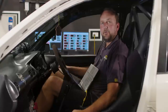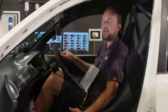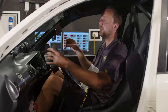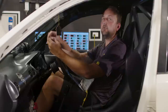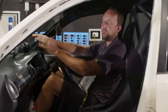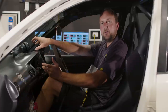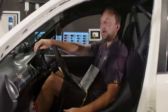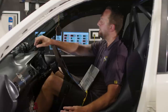The K24A3, the Honda engine, has a fantastic inlet manifold design, and even in factory form, I see power levels changing whether you've got that power pipe bolted on the front of the throttle body or not. By removing the intake tubing from that factory inlet manifold, factory throttle body, factory everything, if you've got that power pipe style thing on the front, adding or removing that, so if we remove that power pipe, you can lose 2, 3, 4, 5 kilowatts.